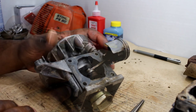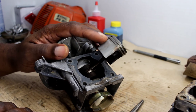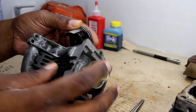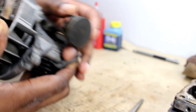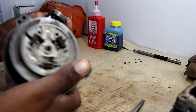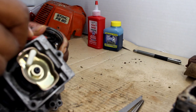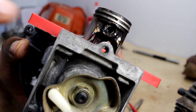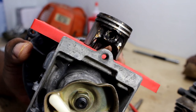Now we're going to take off the piston itself. It's held on — there are some circlips in there, usually just on one side. It's a circlip right in here. When I remove it you'll see what I'm talking about. I just got the circlip removed — it jumped out on its own but I got it removed.